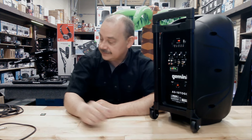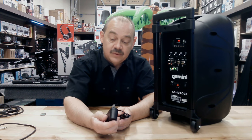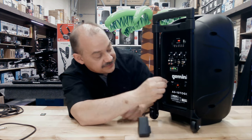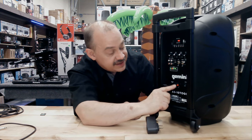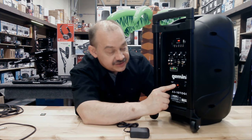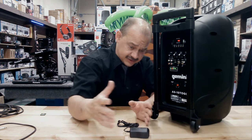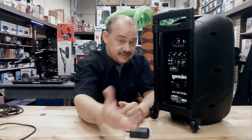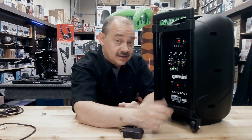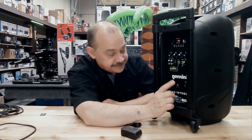Down below we've got the AC adapter plug. The AC adapter is 13.2 volts at one amp — so if you need to buy a replacement, there's the info. You can go up to 13.5V if that's all you can find. Next to that we've got the 12-volt DC adapter connections, so you can plug in straight off a 12-volt battery power pack. If you need to use it all weekend camping, bring one of those portable car-boost batteries — that's like a big tanker truck of gas to keep filling it up with power.